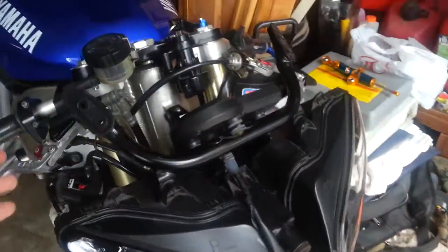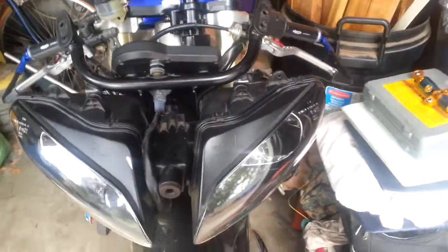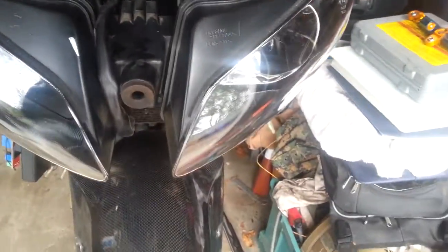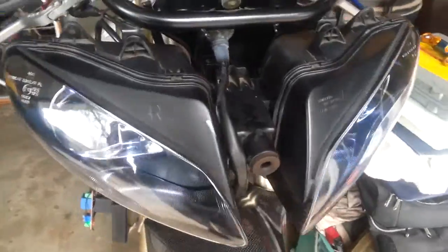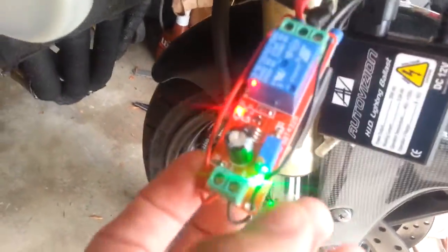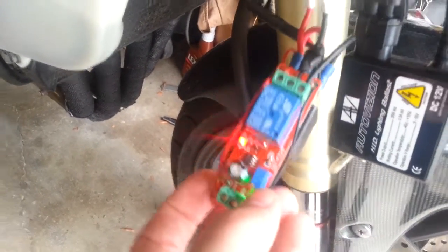You can see I'm doing a lot of other improvements to this, but the headlight thing is my biggest accomplishment so far — it took a lot of brain power. I'll show you once more. This is also adjustable, so you can adjust the delay on this little guy right here. It's got a couple of LED lights indicating when it's on and off, and you can see this little brass screw right here. Turn it counterclockwise to decrease the delay, clockwise to increase the delay, and you've got to turn it quite a bit.